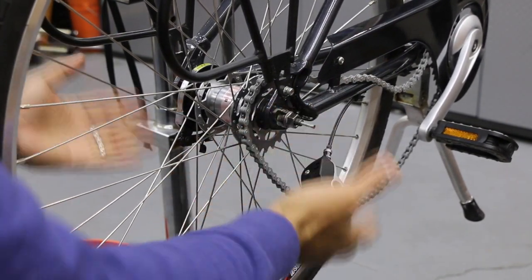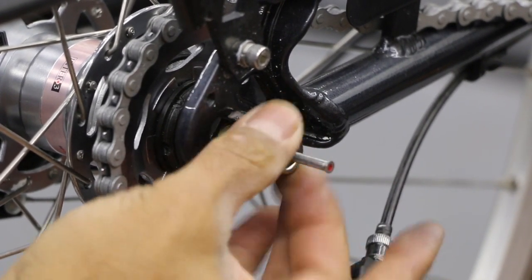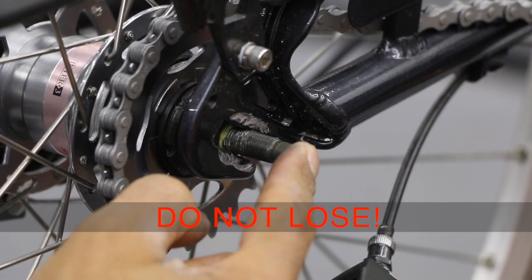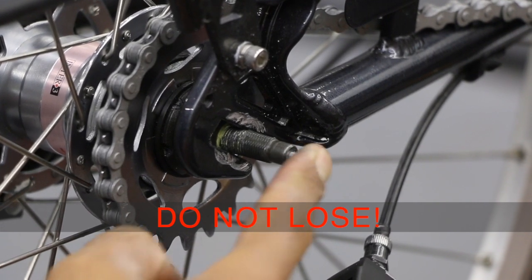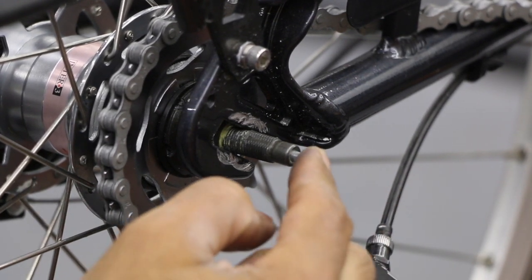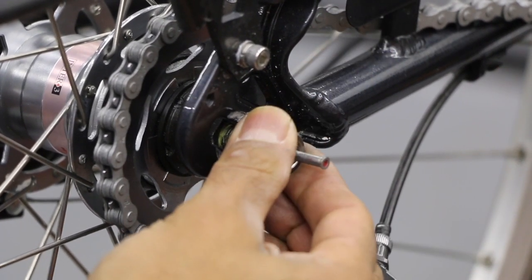Right now the wheel will stay right there, but it will fall, so I've got to be either very quick, fasten it, or don't let go. Notice this silver bolt — the shape is going to be specific to the right side, this is the drive side. Be very careful with this little piece right here — this is our shifting, our little transmission. It's spring-loaded. That's gear one goes in halfway, gear two all the way, gear three — this could fall out and you could lose it. It does have a light amount of grease, probably a white lithium grease. So keep an eye on this — either take it out and put it somewhere safe, or just try not to disturb it. This bolt right here is specific to the right side — it looks like a little top hat with just a couple threads.